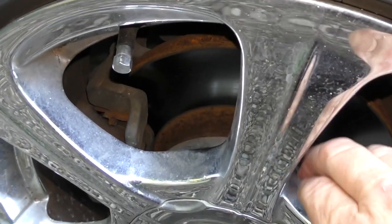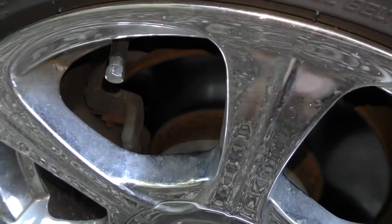There's a type of rust that really doesn't mean anything even though it looks bad — it's called surface rust. On a brake rotor, the parts the brake pads don't touch are bare steel, so of course they get surface rust, but it's thick steel and means nothing structurally. If you go under a car and see a little surface rust on the frame, get a hammer and hit it — if it still goes clang, it's perfectly fine. You can clean it off and paint it with a coating to get rid of the surface rust. But if you hit it and it dents or gets crushed, you know the frame is rotting and it's time to say goodbye to your car.